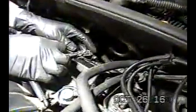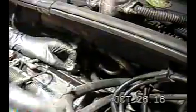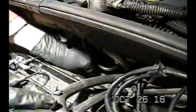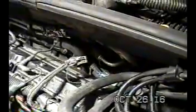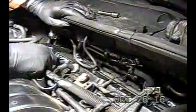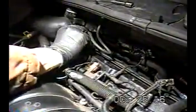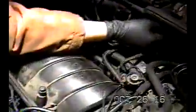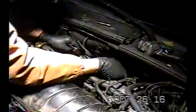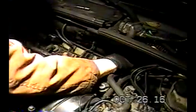So you're going to need that to come off. Now, here's the oxygen sensor for the back bank, and you're going to have to lift this tab up and disconnect this. You can push it back down, one end back down there, but you're going to need to have that disconnected, or otherwise the coil pack back here won't come off. And just like we did before, you have to remove the connection there, and you're going to have to get it out. Sometimes this isn't easy. You may have to pry a little bit with a screwdriver, but this one fortunately is not that bad. So we're going to take this coil pack off.